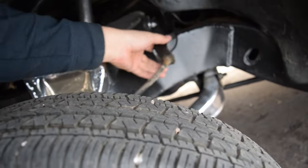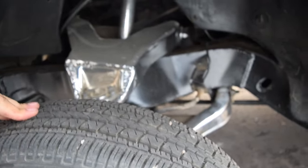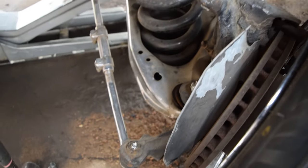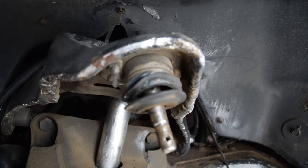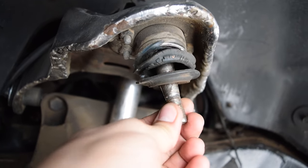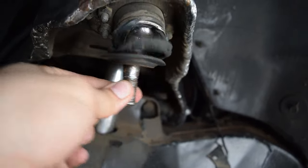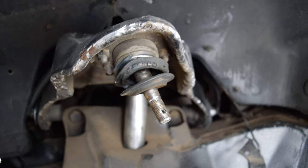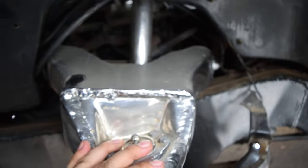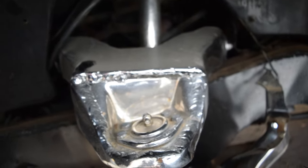Might be having to do something with these brake lines too. We'll see. So wish me luck, boys. As you can see, we got our ball joint separated. This is the ball joint that was in our A-arm. It had a little bit of play, but it's not too bad. We are now going to go ahead and remove this ball joint, which hopefully is easy. Just pull out those four bolts and hopefully it just comes right out. Then we're going to proceed to test fit. More than likely we are probably going to have to drill this out to 5/8ths.